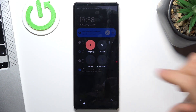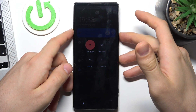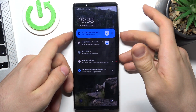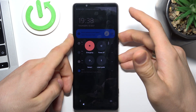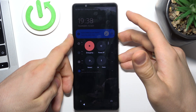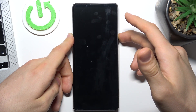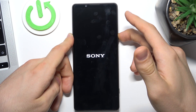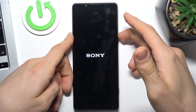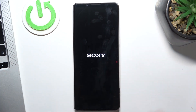But if restart is not responsive, you just need to press and hold. Press and hold the power button and volume up buttons together until your device will be disabled. Then release the power button when the device is disabled, still hold the volume up button, then release the volume button too.